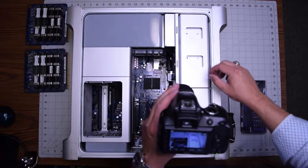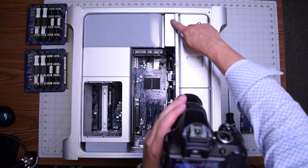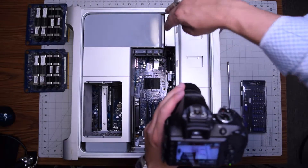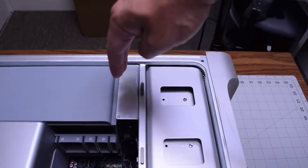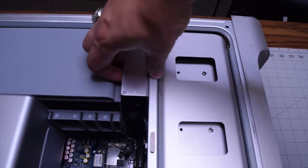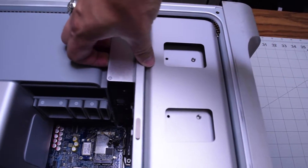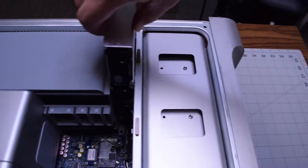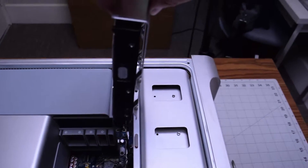There are usually four hard drive brackets running along this line. You can go ahead and remove the hard drive by gently pulling up on the bracket, pulling upwards and having it unhooked from the slot. It just comes right out just like that.